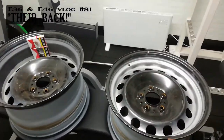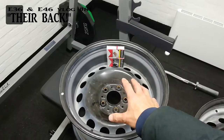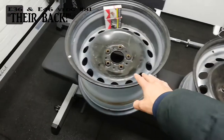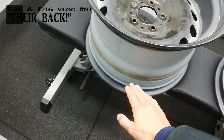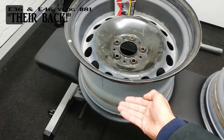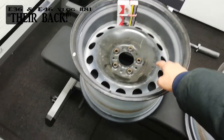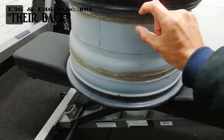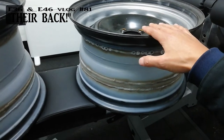What I'm going to do now is twist them and take some measurements. This is a 17-inch rim — that's the least you need for the 330i big brakes. The offset is ET20 at the front and ET0 at the rear. What they did at Rieger is they have it a little bit more to the inside and they put a spacer in it to push it more to the outside. So then you go from ET10, push it out with a 10mm spacer, to ET0. If you do that you can have a slightly bigger dish, but I want to use the original bolts.